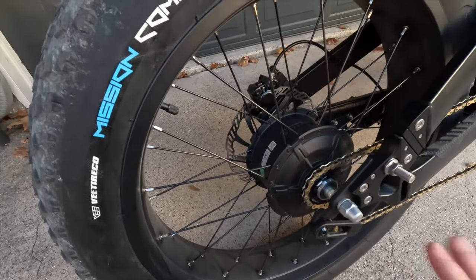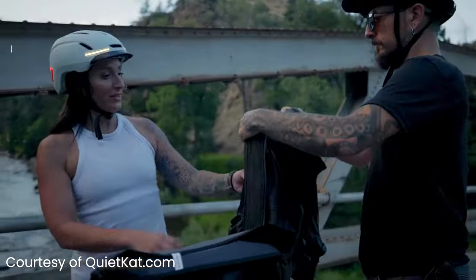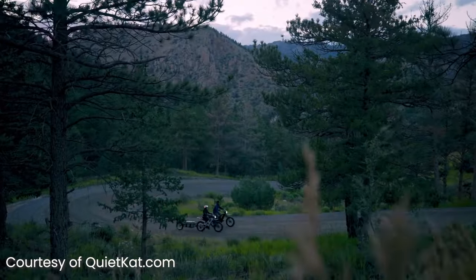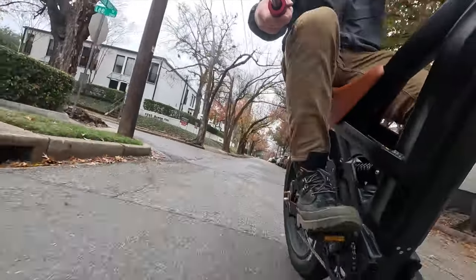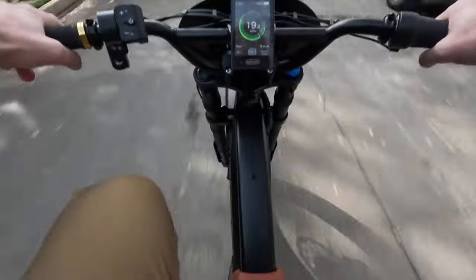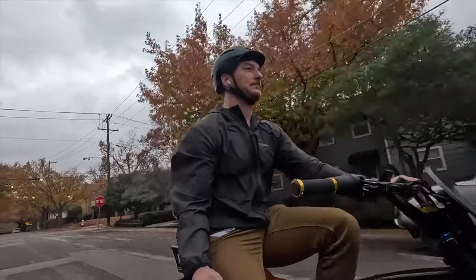What powers the Lynx is a 1000-watt Bafang two-gear hub motor in the back. With a lot of single speed eBikes you tend to over-pedal — your legs spin and you're not effectively moving the bike forward. With this two-gear motor setup you can actually change gears, and you feel a noticeable change in the gear ratio while pedaling. Right as you get to 15 miles per hour your legs start to overspin, then the gear changes and you're right back into effectively pedaling the bike.